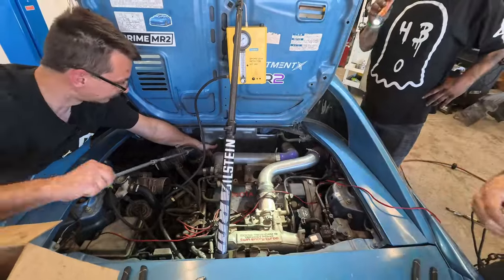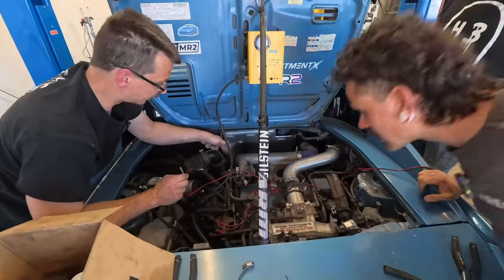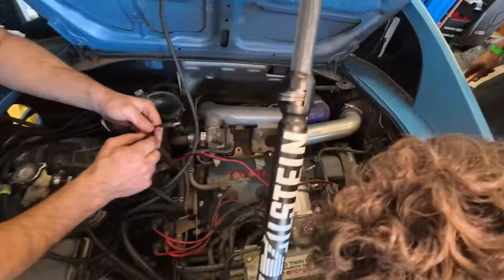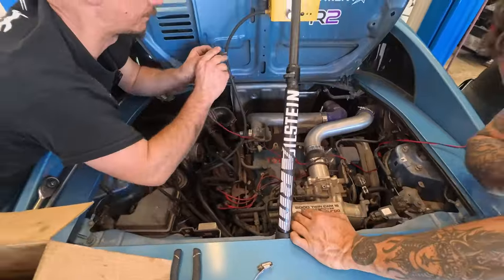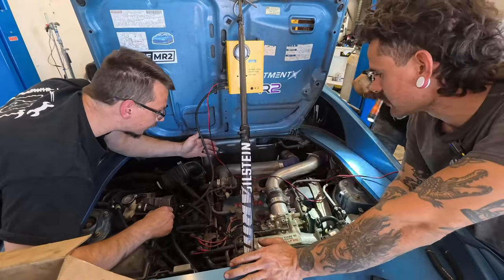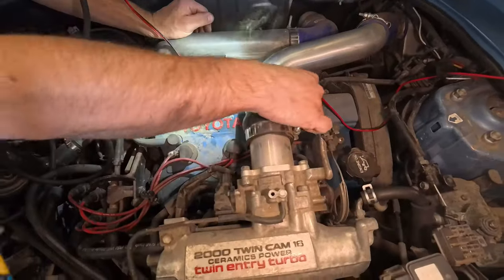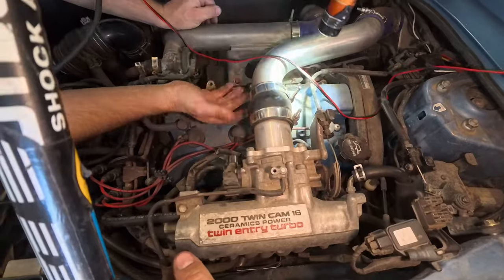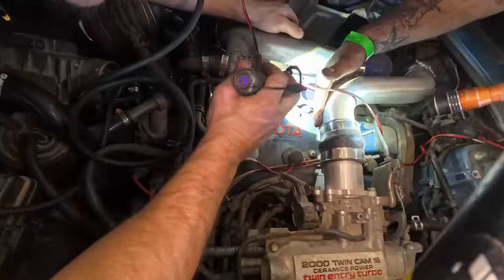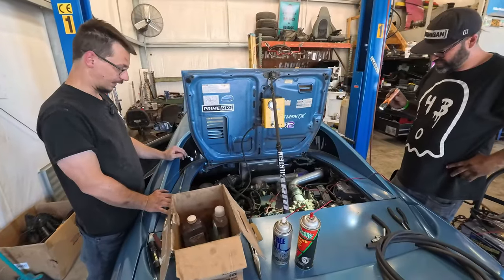The throttle body is probably going to have to come off. But before we do that, the turbo inlet is tight. We found a couple clamps over here that were loose. I think you guys were talking about something under there, but we're just going to see if we have any more leaks now. Maybe it's like that 350Z. Literally just started pushing out. Where? Is this one loose? What? Maybe it's like that 350Z that had the upside down throttle body gasket. Well, we have a lot of the vacuum leaks hopefully fixed. We're going to see if that did anything.